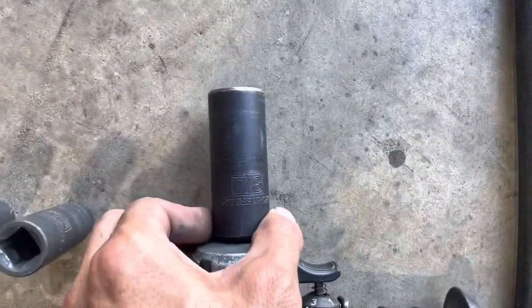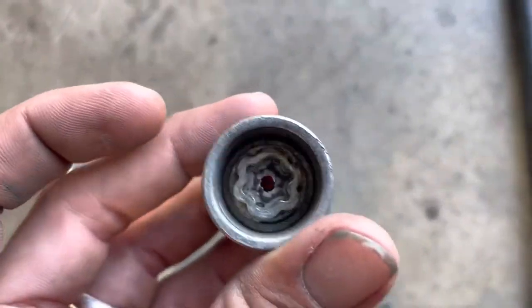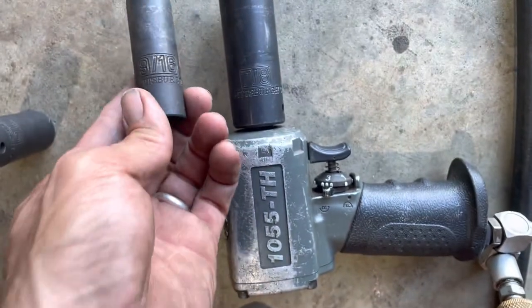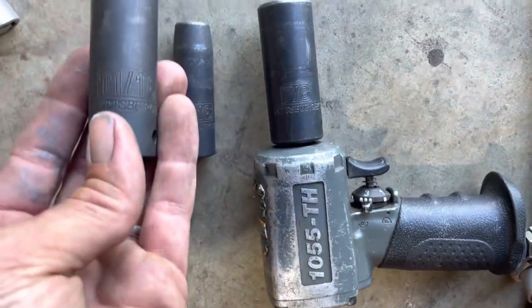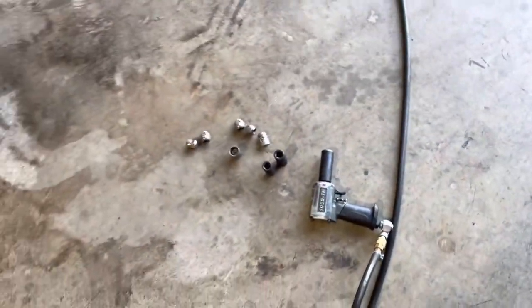This is what's next. So, remove the wheel. You can use a 7/8 socket, and Hondas also run their locks. So go in your glove department if you have it, get your lock out, a 7/8. You'll be able to do everything with a 7/8, 9/16, and an 11/16. Also, transfer that to metric and they'll fit a little bit better.